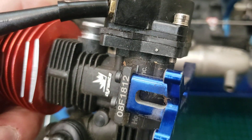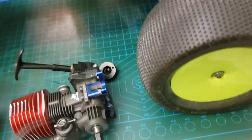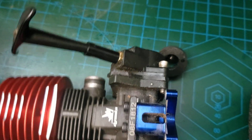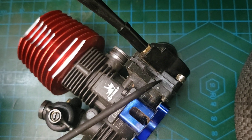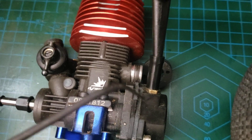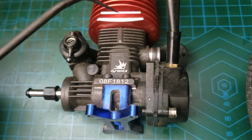So this is the first — the very first generation. You can see that dot. The original ones didn't have that, and if you want to use the Traxxas pull starter they didn't fit. Now if you do come across the first-gen 19 like this and you don't want to make a plastic shim — I think 40 or 50 thousandths thick out of a piece of plastic — you can use an SH 18 pull starter and Pro 15 one-way bearing, and that'll work in there. But they put this dot here to say they revised the issue, which they didn't. It was better but not quite fixed all the way.